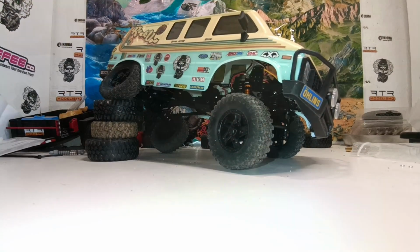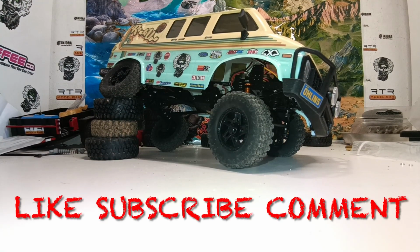Let's just check. Okay guys, and as you can see, we went from having 1 tire and a bit to having 3 tires just by changing to these shocks. And because they got softer springs and everything, with the weight of the van, it actually articulates really nicely. Once we fit the rims and some brass rings inside the rims, then I do believe the suspension will work even better because it'll have some weight down at the bottom. But you know what guys, it's turned out really well, and I hope this video helps you guys also get your double barrel shocks fitted to your van.